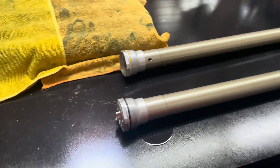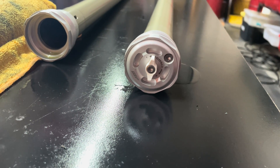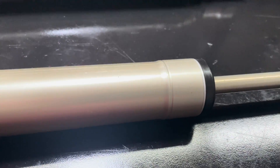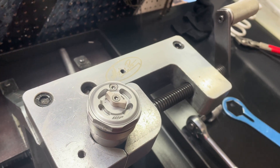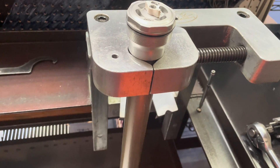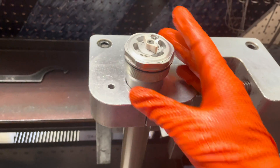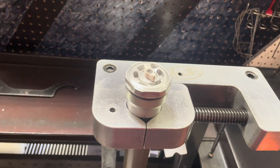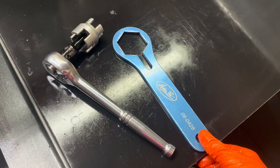Before I do that I'm going to get this cartridge mounted up into our vice. I'm going to remove our compression assembly just like we would on our previous versions, as the install is identical to those. Then we're going to get this mounted up in order to remove this. I have the cartridge fixtured in our vice. Not everybody's going to have a vice like this, so what I want to point out is I don't really have the cartridge clamped that tight because it is round and the walls of this cartridge cylinder are very thin.